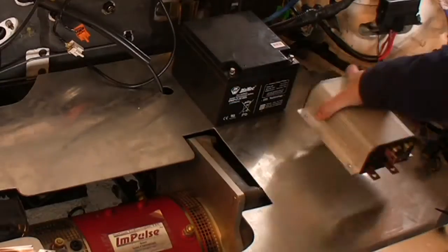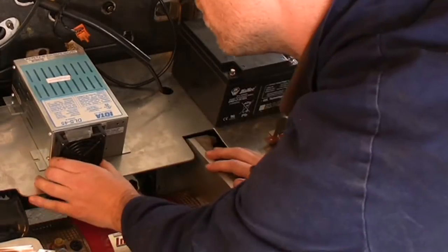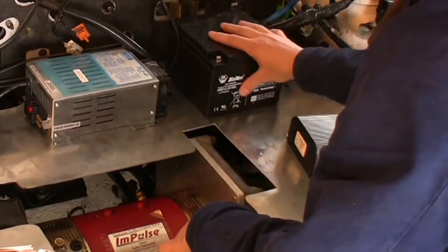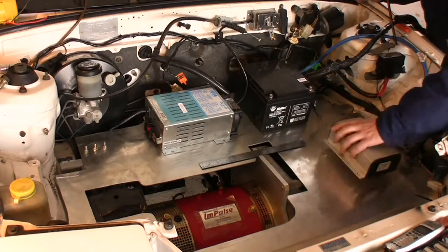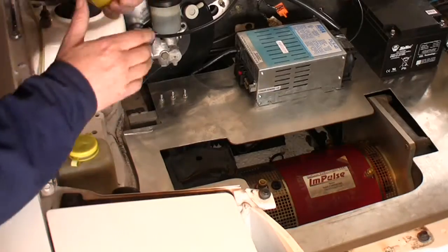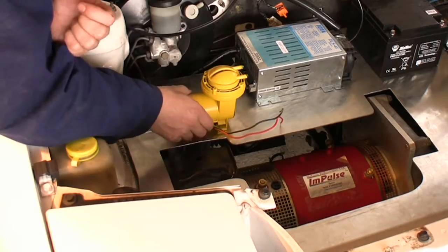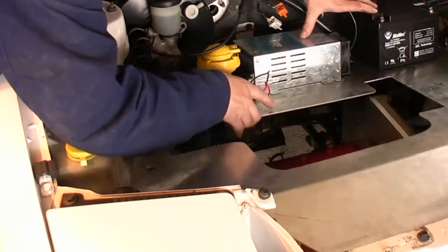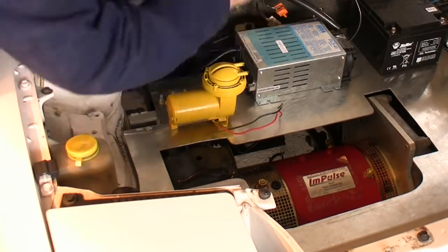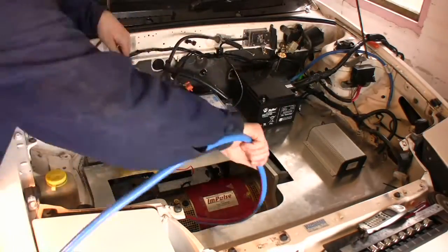The next trick is to figure out where to put all this stuff. I've got my Kelly controller there - it's kind of small and I might want to replace it with a Ziva, a Zilla, or a Curtis controller later. So I'm leaving some space there and checking that my tilting plate can tilt and the components won't get in the way of the firewall. I've also got to take into account the cable run, and I've got my brake vacuum booster - the pretty yellow thing. I've got to worry about the pipes going into it and whether the plate will still tilt when I mount it.